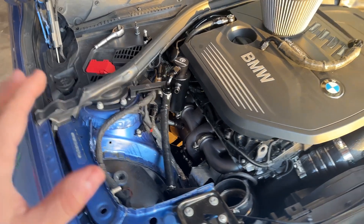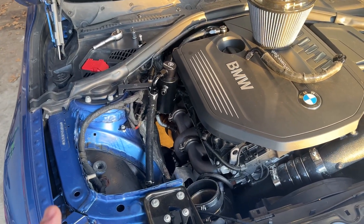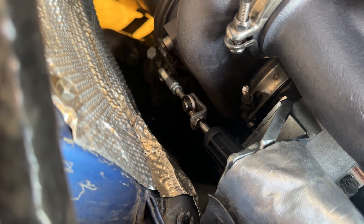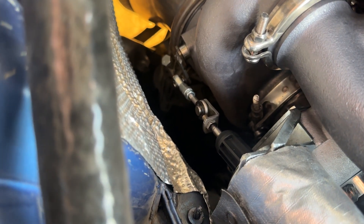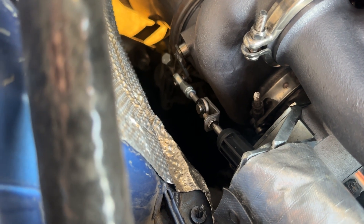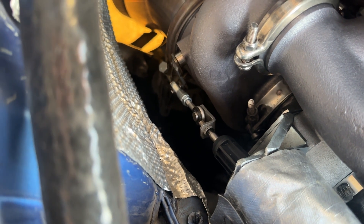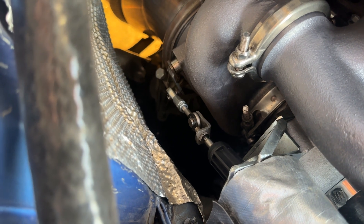So it's related to the wastegate. If you have any wastegate codes on any wastegate you've touched, this could be it. Now if you notice on the factory wastegate, you would have wax or paint marks on the nuts — you don't have those here. Those wax and paint marks kind of set the area it's supposed to be in, but they also act as a buffer preventing the nuts from backing out. With all this heat and vibration in the area, that can happen.